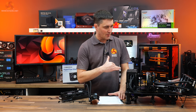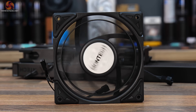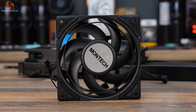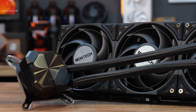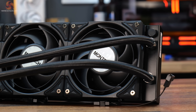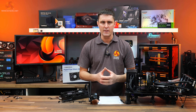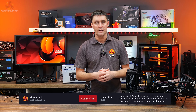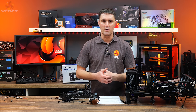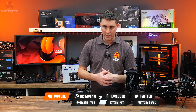Our advice: if you buy this AIO and performance isn't as expected, check the mounting pressure, remount the cooler, and see if performance improves. It's not that we wouldn't recommend this cooler — it's very competitively priced, and when seated evenly on AMD AM5 CPUs performance is reasonably good and in line with other similarly priced coolers, but you need to pay extra attention during installation. The 'Silent' name is a bit of a gimmick — it's not truly quieter or thermally better than the original ARGB at 40 dB normalized, and there are quieter coolers with similar or better performance. But for value for money once mounted correctly, it's pretty good. Let us know what you think in the comments, and don't forget to like and subscribe.